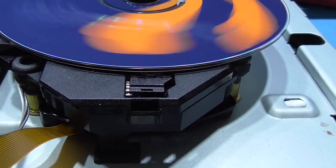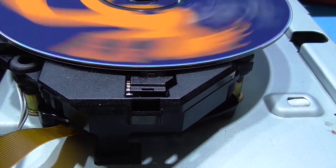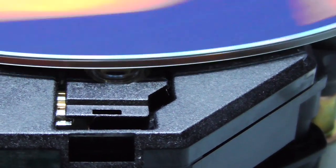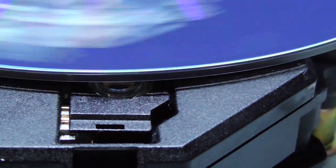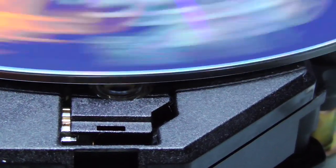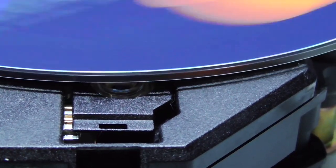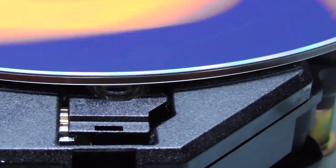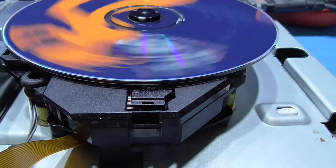Back again. I just thought I'd show you what it looks like when it's reading the final track. That's what I mean — you need a disc where it's reading the very edge. If I can zoom in on that... it's very, very close to the edge guys, and that's the more difficult part for the optical pick-up to read. You can actually see the wobble of the disc — remember when I was talking about the wobble? Can you see the disc wobbling and the focus lens going up and down in unison with the disc? Yeah, that's the final track — the one I'm going to be doing all my measurements on.